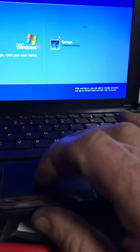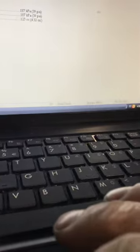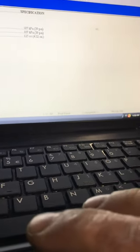Okay, just regular old AllData program here. I'm just gonna get some specs. Here's a Ford Escape 2005 — it is '05. We're gonna jump right to fuel pressure specs. Key on, engine off: 39 psi. Engine running: 39 psi. So I'm not okay with that 15 psi.